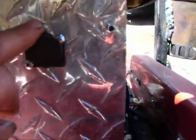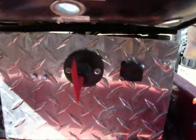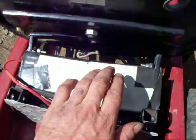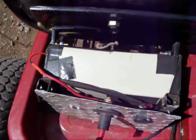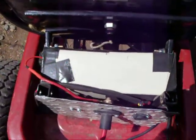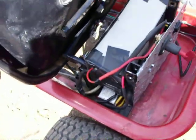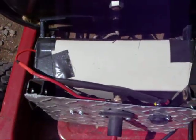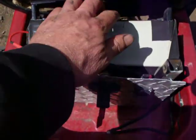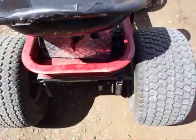There's a charge port there — stick a charger in, XLR port, and a kind of industrial key switch. We made our own battery pack: there are 18650 cells in here that we got in bulk packs, and there's a BMS in there — 14 cells in series, four in parallel, a 14S4P pack. That thing rips. We opened up the controller and found 60-volt capacitors in it, so 14S is about as much as we can run without getting into trouble. The sheet metal enclosure is just old computer cases from junky 90s computers — that's good galvanized metal. We fold it up and put our batteries in there in case they light on fire, which I have been involved in something like that before. It's very exciting when they're on fire.